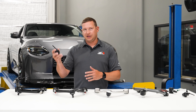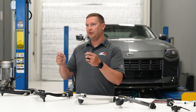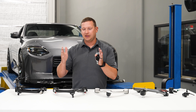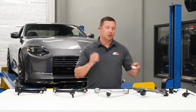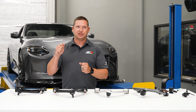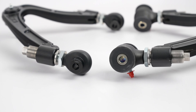It just makes the car feel super sharp right off a tip-in or at all those corrective points through the steering arc when you're making changes to steering angle, but also the load and shift of the suspension. Things are squirming and trying to move around there, and they just can't do it with these, and you really feel it from the driver's seat whether you're pushing the limit or just enjoying a casual cruise. Big difference in that tip-in and steering response between race and street.